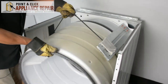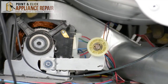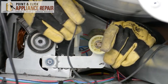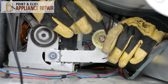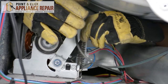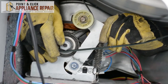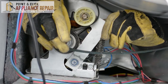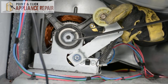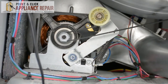We're just going to slide that in. Now to put the drum back on, we're going to take the belt and go on the other side of the wheel here. We're going to lift it up and then loop the belt around the shaft here. Make sure everything's on straight, and then everything should be able to spin freely.